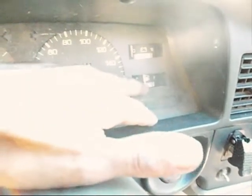It also changes your rev meter to an amp meter, so you can see how many amps your motor's drawing as you're driving. And I don't know about the other knobs and stuff on there, but at least most of the dash will be working, so convert it over. I'm either going to be just wiring it up so it has the battery gauge and the speedo working, because, to tell the truth, I'm not too fussed about this, and I'm thinking of making a foam insert that goes here, so it looks professional, and so you can mount a small monitor in here, because there's going to be a monitor that comes with my BMS unit that tells me all my information on battery status and temperature and that kind of stuff.